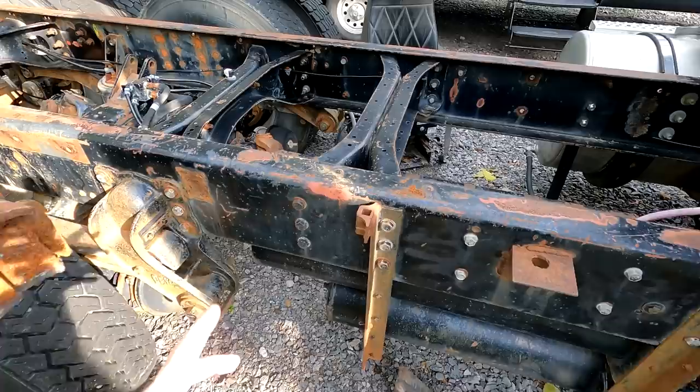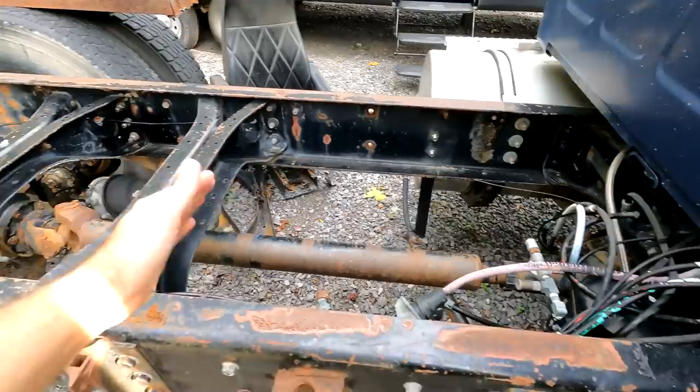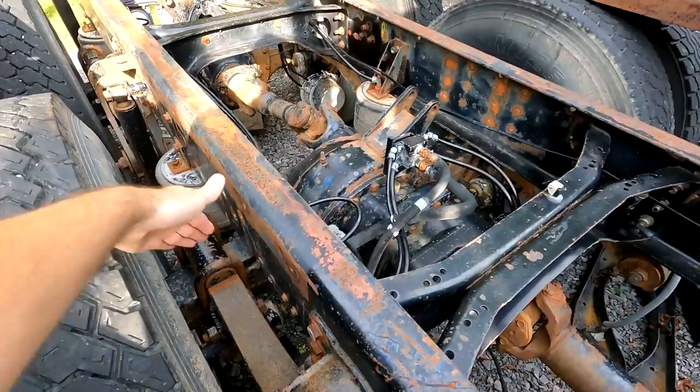We're going to have to lengthen the drive shaft because these axles need to go back about 18 inches. So the 60-inch sleeper, which starts right here, you can see the mark, will fit, because right now it won't fit. It goes to right about here and it's going to hit these tires. So those need to go back. With all that said, let's go ahead and get started.